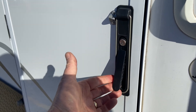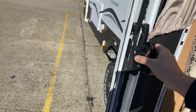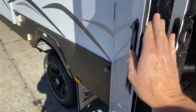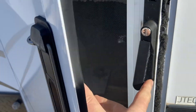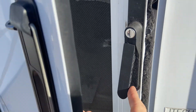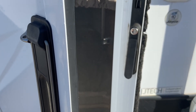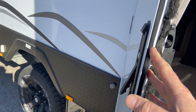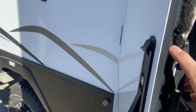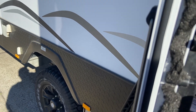The handle pops out and comes out like that. These two doors have a separation system and a tri-lock operation. These are probably the simplest of the door types. This handle is however notorious for breaking off, but it's quite straightforward to repair — both halves of the door lock mechanism need to come out. This style doesn't have a mortise piece that goes into the door frame, unlike the Hume or the Aussie Traveller.